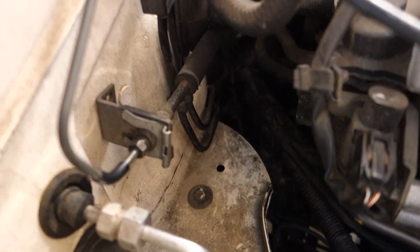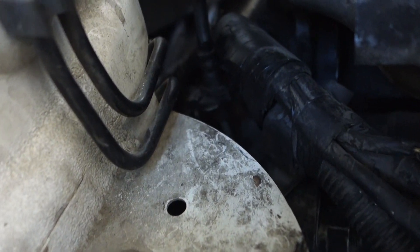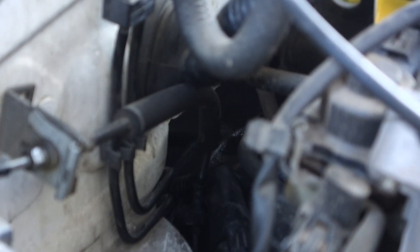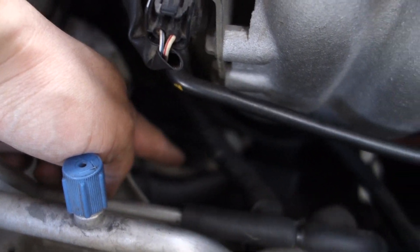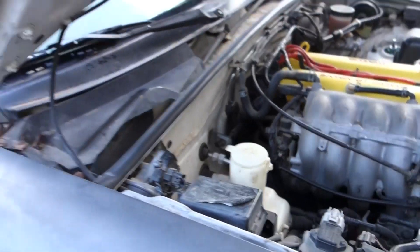My dad found the issue. Following this line that goes to the clutch reservoir - it connects right here to a rubber piece. My dad made the observation right there: it's leaking. Every time we pop the clutch, a whole bunch of fluid just comes out. We did not see that until right now. I have to order the flex hose - that will probably solve my clutch issue. We were always working right here at the bleed nipple and never noticed it until now. The fluid is just gushing out like it's torn.